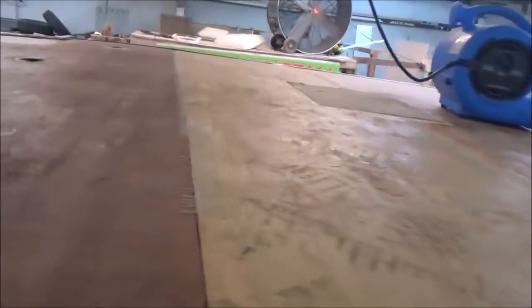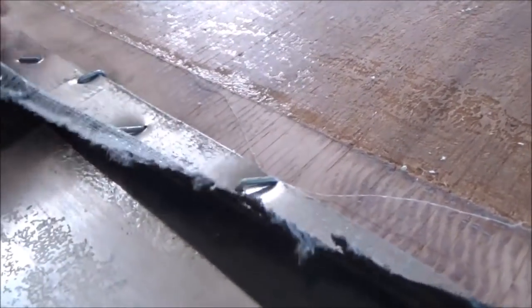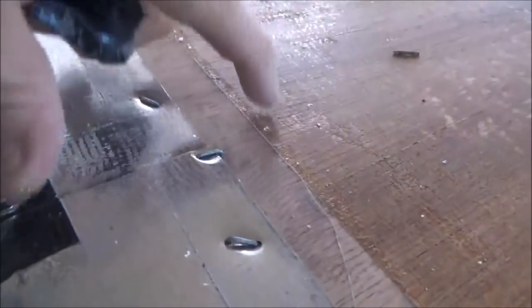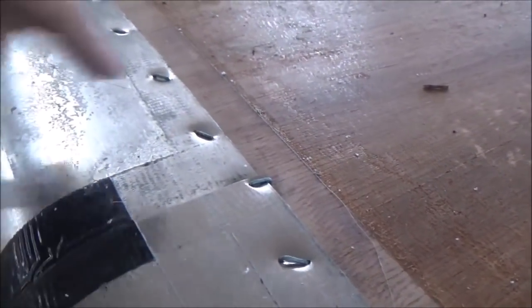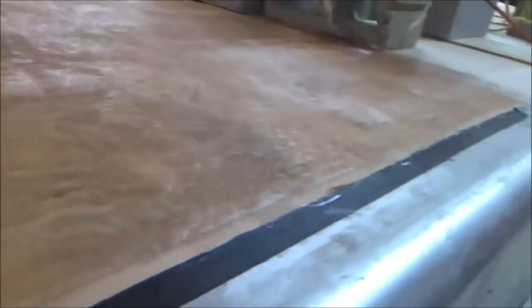Most of the time you don't have applied foam on a fifth wheel — a lot of times you'll see it on Class A's and Class C's. On a fifth wheel I've had a few come in like the Titaniums — those ones have been built with more insulation. That's why we had to laminate this back together. Now all they put on here to protect these edges is just drywall mesh and duct tape — that's not going to do very well. Look at that staple underneath there. We're going to make sure all this is down proper and then put 60 mil commercial grade roofing strips in here to protect it. The main roof will run over the shoulder and get tucked back in where the gutter and turn bar is.